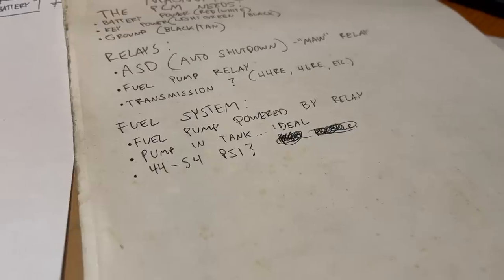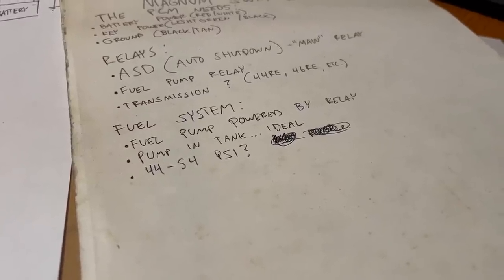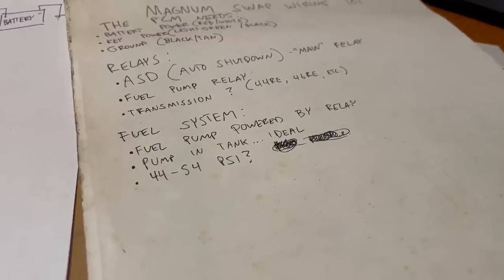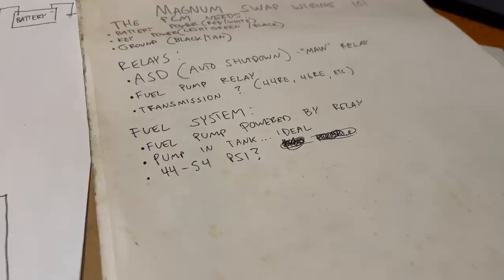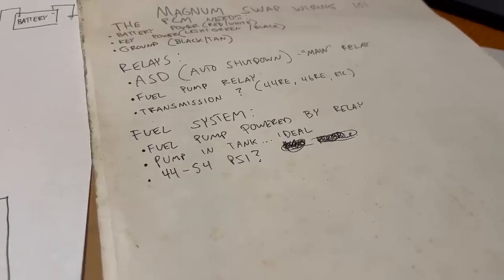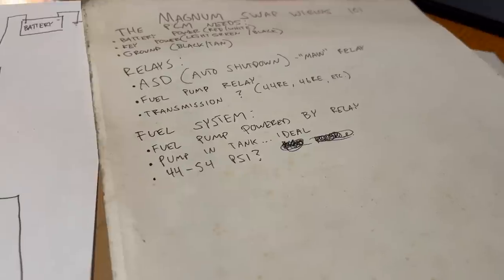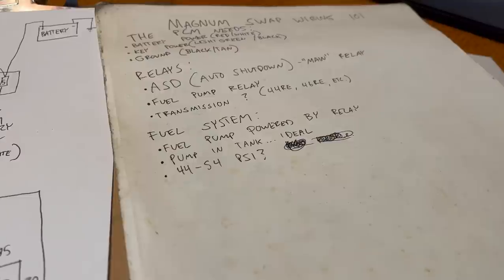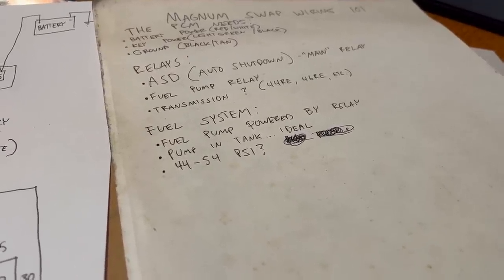The easiest way to accomplish this, for our purposes, is a separate regulator, which you probably want mounted under the hood with a return line running all the way back to the tank. That way you can reach it, you can adjust it, and those regulators can often be vacuum referenced. The vacuum reference is nice because it takes away extra fuel pressure when you don't need it. That can help keep your fuel trims in the realm of reasonability and help you save fuel.